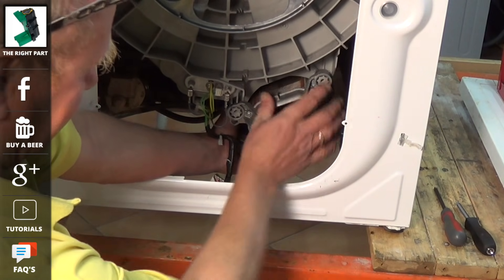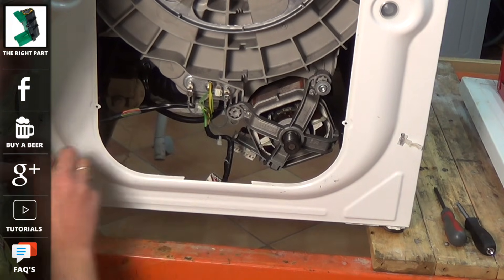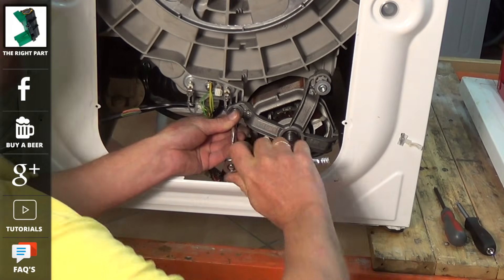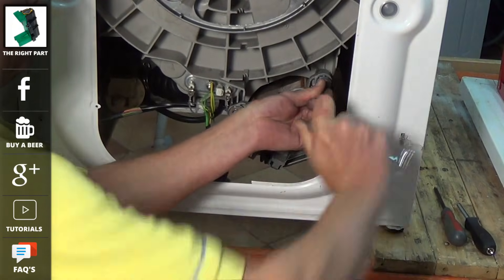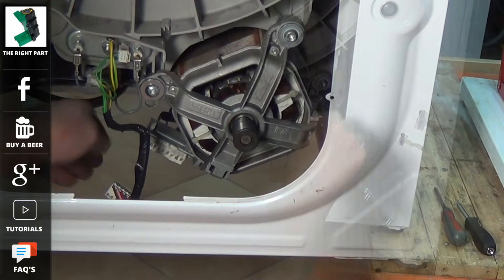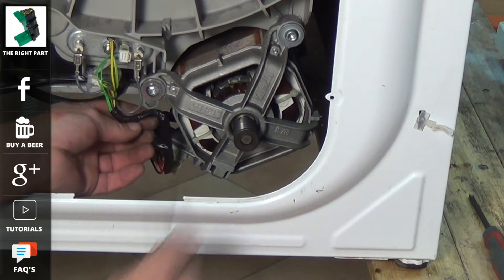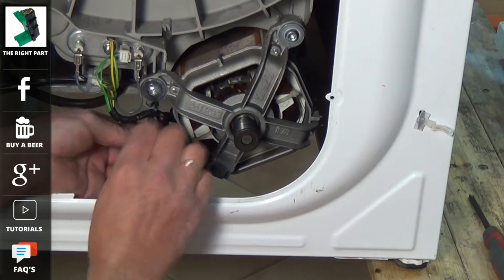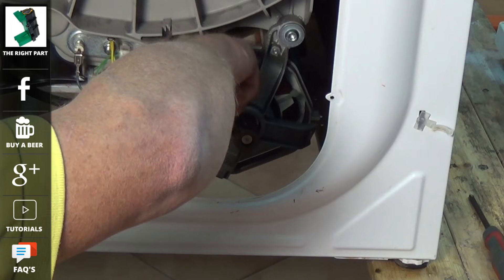Now we'll just fit the motor. Just from underneath, put the motor onto the lugs — make sure you get the front and the back on — and then do up the bolts. Please remember to subscribe to our channel whether it be on Facebook, YouTube or Google Plus. When fitting the motor cable, do remember to get yourself a cable tie and put the wiring harness back through here, as this will stop any metal fatigue within the wiring so it's not moving all around, doesn't get caught on the belt or anything else — it just keeps it all neatly tucked away. Then cut it off after.